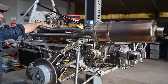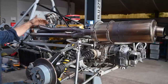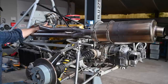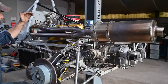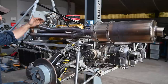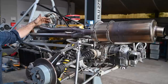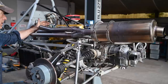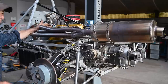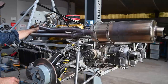The engine is a Kent 1.6-liter engine. You certainly want to check the compression once you buy a car, make sure it has no leaks, make sure it runs - I did all this before. You want to check oil pressure, do a blow-by test making sure you don't have any leaks through the segments. This engine is smoking a little bit because it has some blow-by - you need to let it warm up to be fair - but overall the engine looks pretty good. It's even a dry sump engine. It has a Hewland gearbox in the back - also called a dog box.